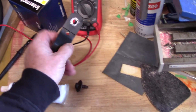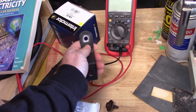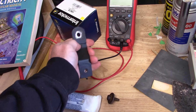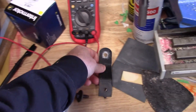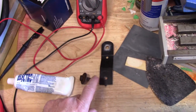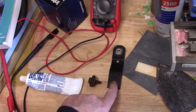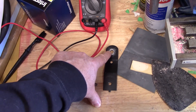Now that we've got this little piece painted up, I wanted to make sure I went back and cleaned off that paint so we're going to get a nice grounding through this. So what I'm going to do next is verify the ground from just inside of the threads on this side of this bracket up through this part which we just added to it.